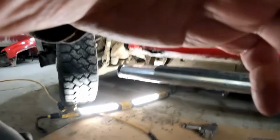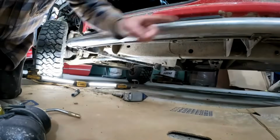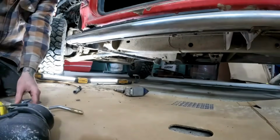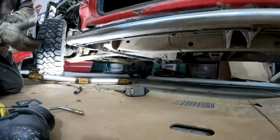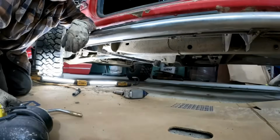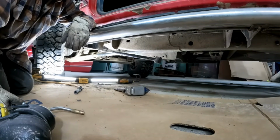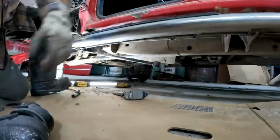Now, if you're familiar with this style of board, of course, these are the 3 body bolts, the 3 cab mounts is what these are attached to. Now these body bolts, these cab mounts, they're on bushings. They don't need to be, I mean, they need to be tight, obviously, it's holding the cab to your frame, but they don't need to be Herculean tight.